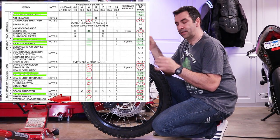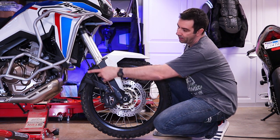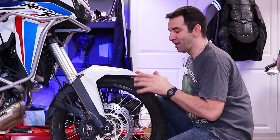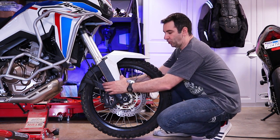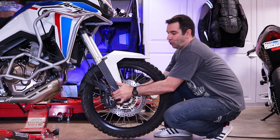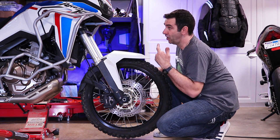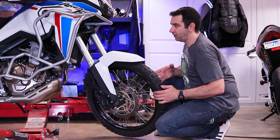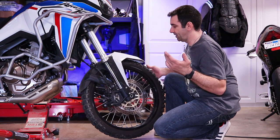It's now time to check the steering head. I've lifted the front wheel off the ground using a jack and a stand in the back — two people would be best, one to make sure the bike doesn't tumble and one up front. Grab the front fork and give it a good shake. If you feel a clunking sensation the steering head needs to be adjusted or the bearing replaced. Also move the front from side to side — it needs to be smooth and easy to move. Mine is very smooth with no problem, so the steering head is still okay.